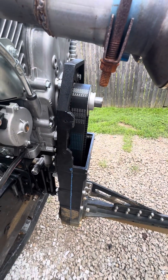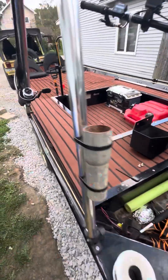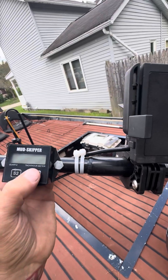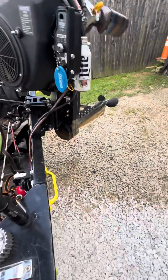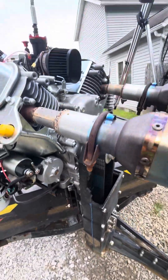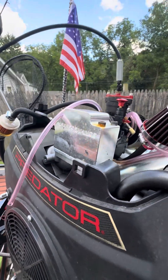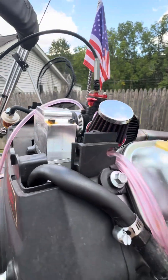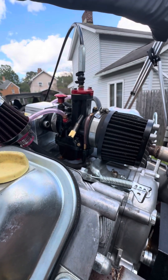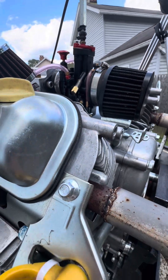I was only getting a couple of hours out of them and they'd just trash, leaving me stuck on the river, which isn't a good time. I think there's about 20 hours on it now. The motor's got a little bit done to it — I have the performance 670 adapter from Performance Machine and Design, a $35 Amazon carb, and I'm running a 135 jet. I live in Pittsburgh if that helps anybody out.